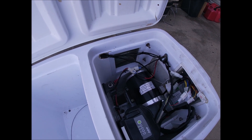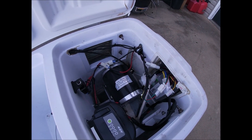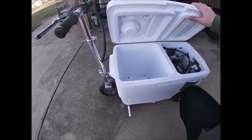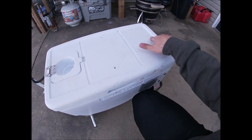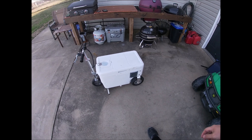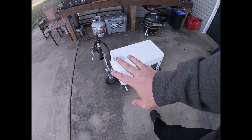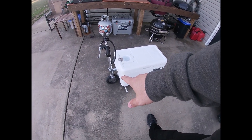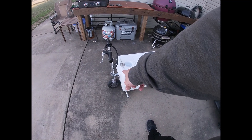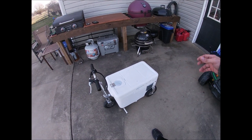I found a little bracket and mounted the breaker on it. Everything's wired through to the speed controller, which is mounted. The 800-watt 36-volt battery is mounted. Chain tensioner's on, chain's on, all the tires still hold air — these are all original. It doesn't have the cushion anymore, but it works pretty good now — actually a lot better than it did. It's ready to hold beer or whatever your choice is. Pegs work. I definitely need larger wheels, and I need a brace for the front, or I really just need to rake that out and put a slightly larger tire on it.